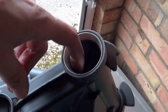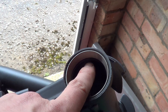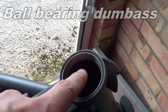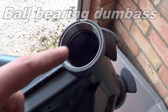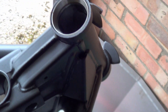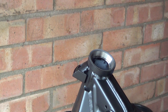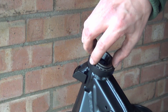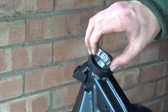Now you might notice one thing — this bearing taper is actually smaller than the tube, unlike your roller bearing ones. Getting this out is going to be a nightmare. So do remember that you have to get it in straight using this tool. Because if you don't — even if you get it halfway in — it is a bloody nightmare to get them out. So now we've got that done, you can see our roller cage sits in there.